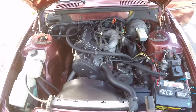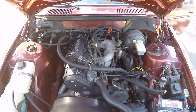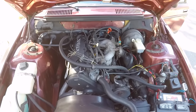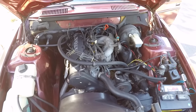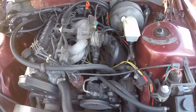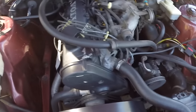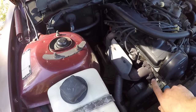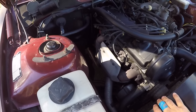This was an automatic car when I got it, and it was about a five-hour swap to go to a manual — the biggest thing is just collecting all the parts. It now has an M47 five-speed. I did that swap alone in a garage on ramps, not even jack stands. There's plenty of room for whatever you want to do in here. All the turbo stuff from the turbo models can swap right over — it's all bolt-in.